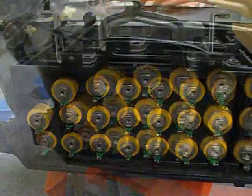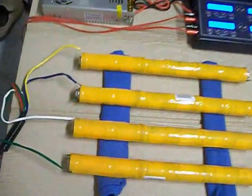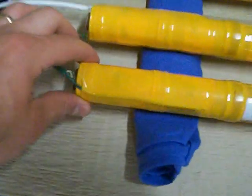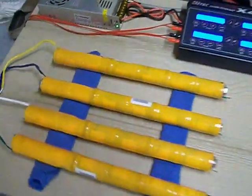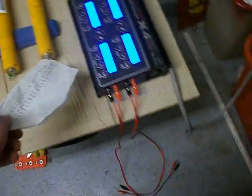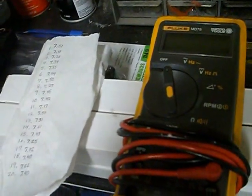I've removed the sticks that have a temperature sensor attached to them first, just because I don't want to have to cut into those unless I have to — hoping all these sticks will still be good. A key thing you want to do before charging is go through the user manual and do a default preference setup. I also took a DVOM and checked the voltage of each one of these cells and wrote it down.